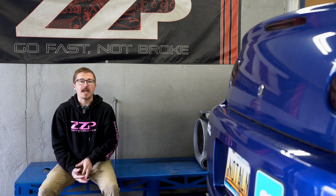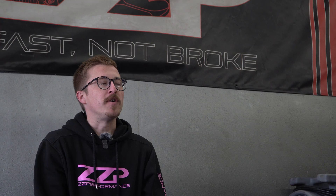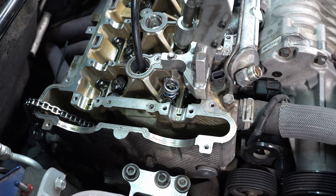Because it's been so many years I just wanted a nice good baseline as an A test, because coming at you shortly we're going to spice things up. Old Blue here is going to get some stage two ZZP cams and 82-pound valve springs. From the factory the stock camshafts are mild — intended for your everyday daily driver buying these cars brand new back in 2006 — but they did leave quite a bit on the table, especially when you start increasing airflow. The valve springs in the head are all original, pretty worn. So stiffer valve springs, higher lift, more duration on the cams.